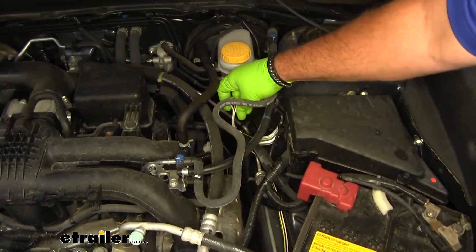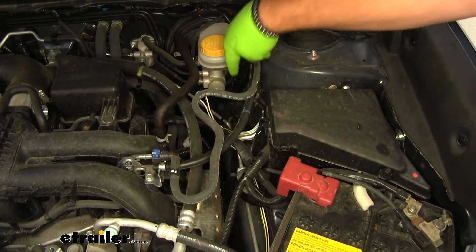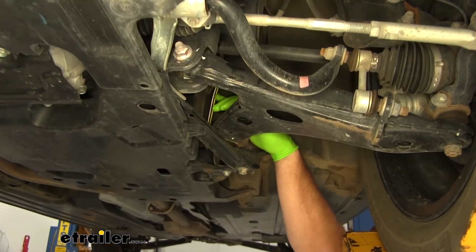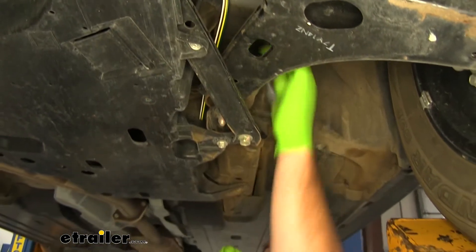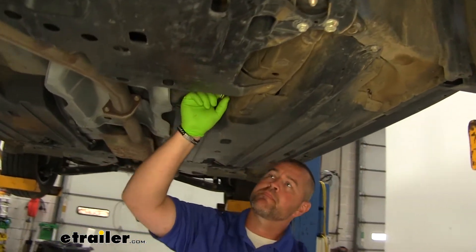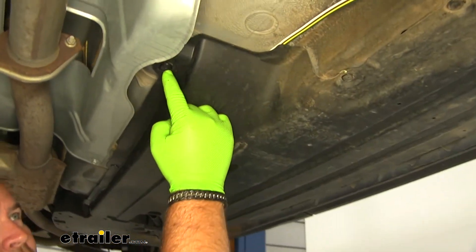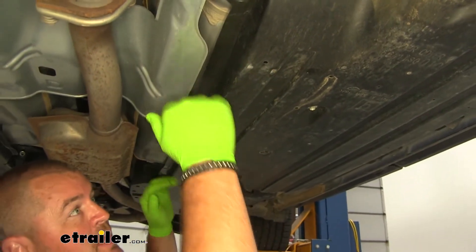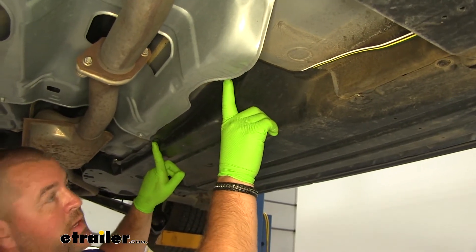I bundled a little bit up here because I'm going to have to tie into my braking system. Bring it down right next to the firewall down to the bottom. You want to make sure running it, stay away from anything moving or hot. I went over top of this panel — took a flathead screwdriver, popped this out, pulled down this edge, took my wiring, tucked it up underneath, and put the fasteners back in.